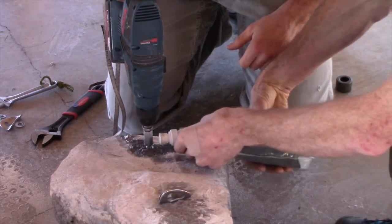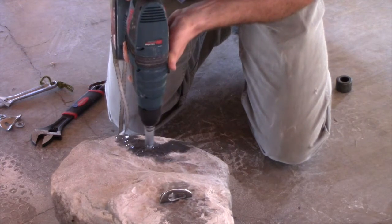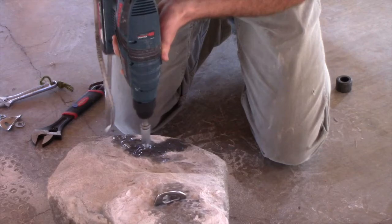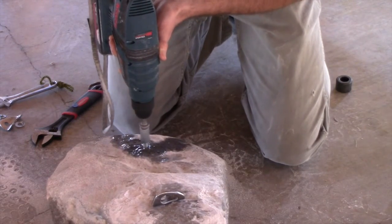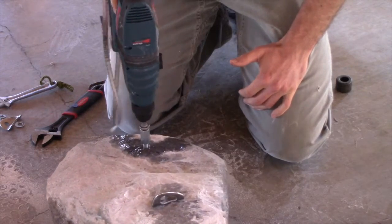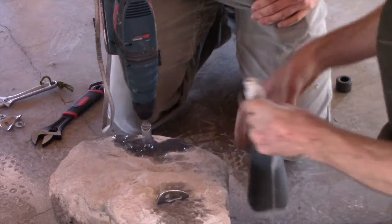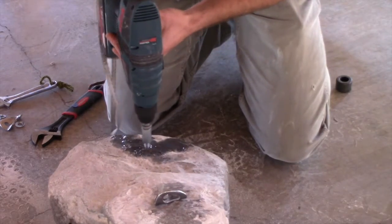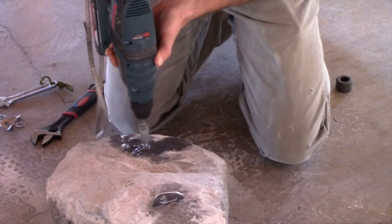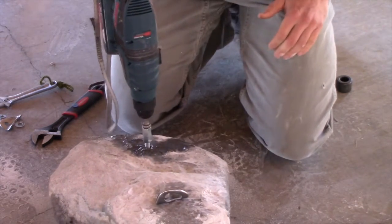Often it'll be sizzling at this point. Pull out a little harder. Stop — and we're going to add a little more water. The point of this part is: we're damaging the pyramid shape of the wedge. If the wedge is no longer a smooth pyramid, it can't function as a wedge because the collar has stopped against the part we've damaged.